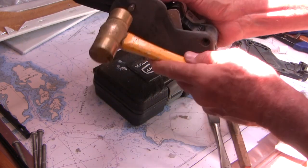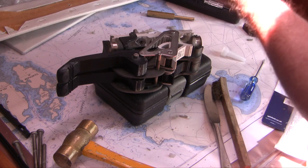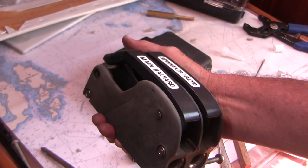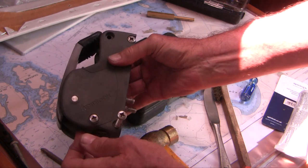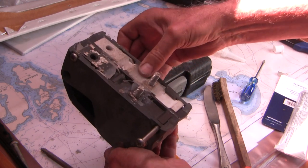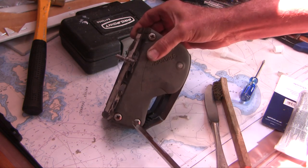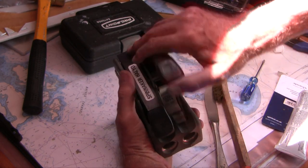That looks right. Now the other wall. It's worth noting that these nuts can go on either side — they're captive nuts, but if you look at the design it could be either way. Think about your design as to whether you want the Phillips heads on which side. Normally when these require service they need to be completely unbolted from underneath anyway. Good practice is to use a criss-cross pattern when finally tightening them up — you don't have to go crazy here. Then a last-minute check to make sure it works properly.